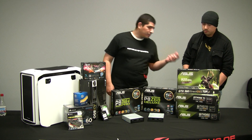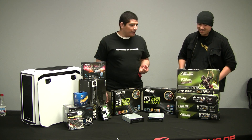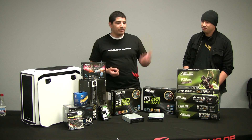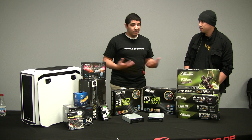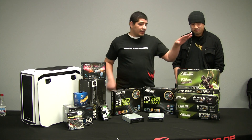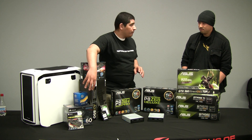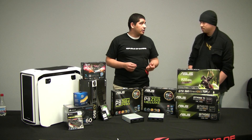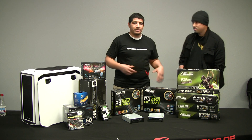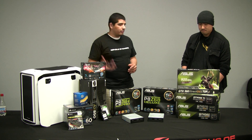Well, I know for you, Chainor, you love to frag people online and record those videos, upload them on YouTube, and brag about your kill count. But those videos after you've saved them can be multiple gigabytes. If you want to upload online with a slow upload, that could take quite a bit of time. Or if you want to put that on your phone with only four gigs of space — the cool thing with the virtual technology we feature on our Z68 series is that the user can be playing their game while simultaneously accessing the fixed-function chip built onto the Sandy Bridge processor and the transcoding technology. This allows them to cut down transcoding time and output a significantly smaller file — dropping from maybe four gigs down to 500 megabytes, which is much easier to transfer or upload online.